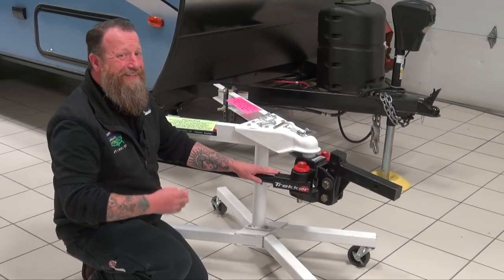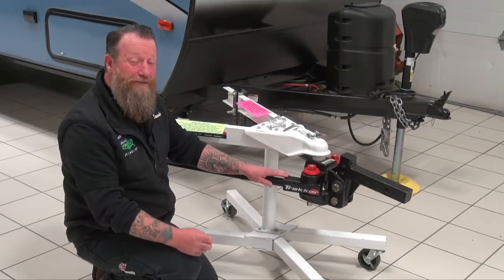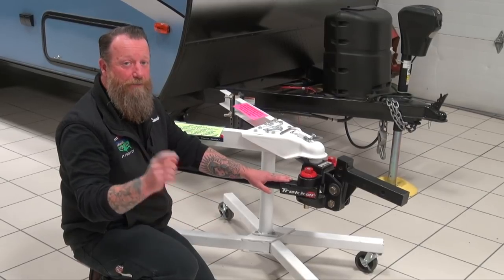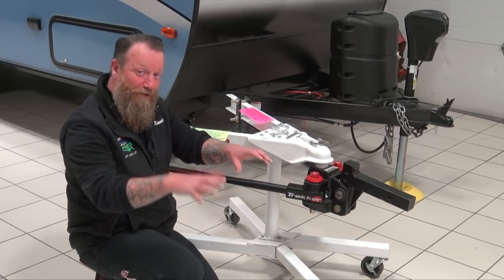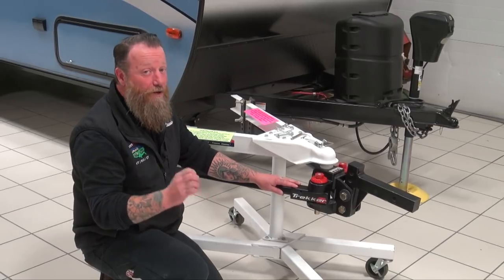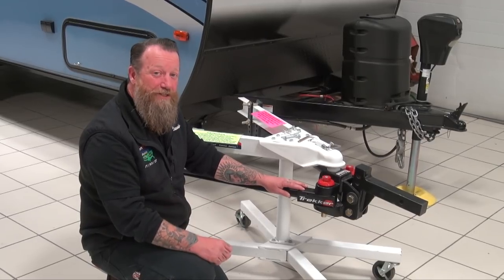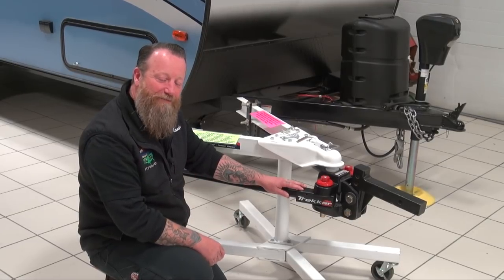With those P-rated tires, half-ton trucks are great trucks to go down the road. D-rated tires are very expensive — the kind we run on heavier trucks — and they help combat sway. Running a premium hitch with your travel trailer at highway speeds is going to keep you and your family safe and make it a lot easier for the driver, so your wife isn't white-knuckling it the whole trip. Make sure you know about the hitch you're purchasing; if you're running a half-ton truck with a larger camper, make sure you have a premium hitch providing as much anti-sway and load leveling as possible. Thanks for watching Pete's RV TV with Randy today — I look forward to seeing you on the road.